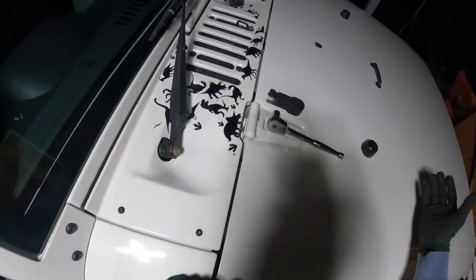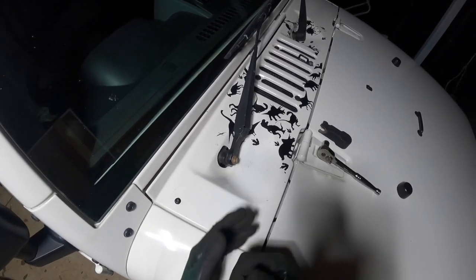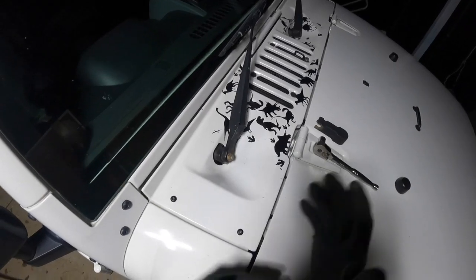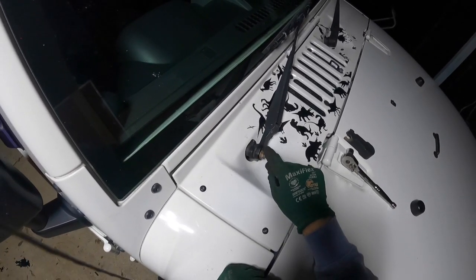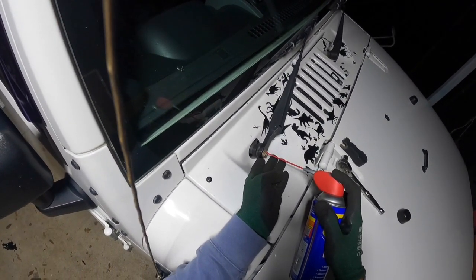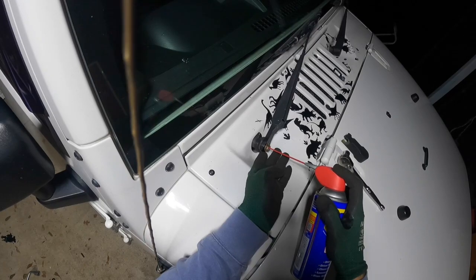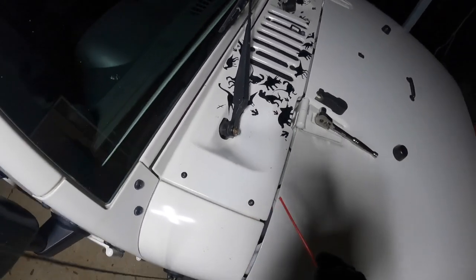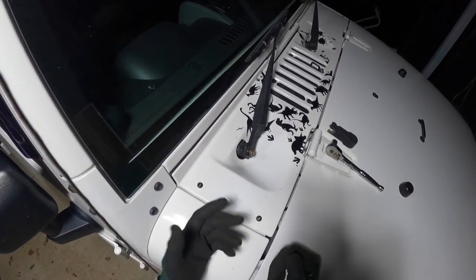Our one's been off before but you can see it's a little bit corroded. If you're four-wheel driving, maybe somewhere that snows, there's salt on the roads, or you've been doing some beach driving — a lot of corrosion ends up building around this nut. So it's a good opportunity to get your WD-40 and give it a couple of sprays just like that. Never hurts — let it soak in for a minute or so.